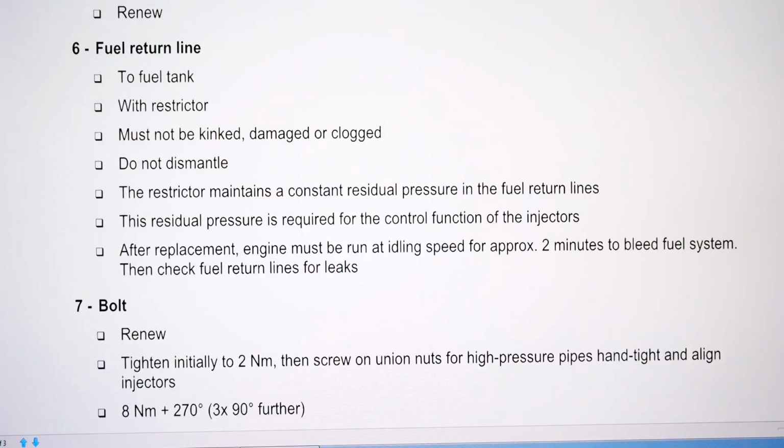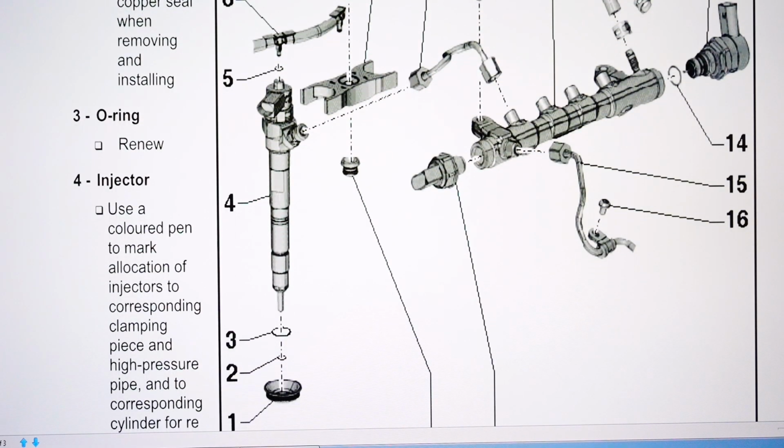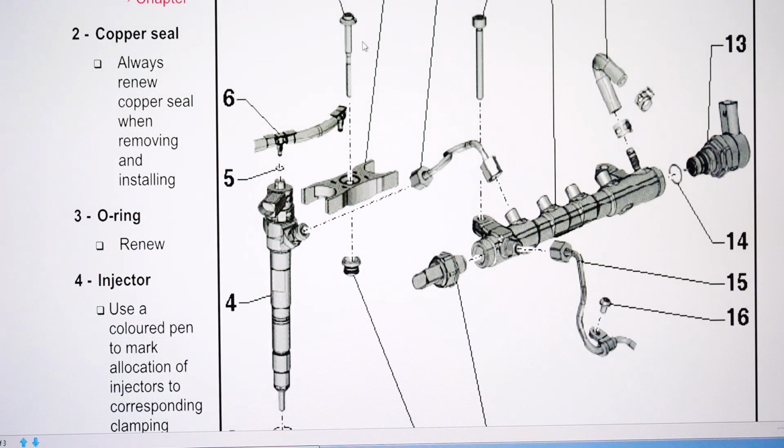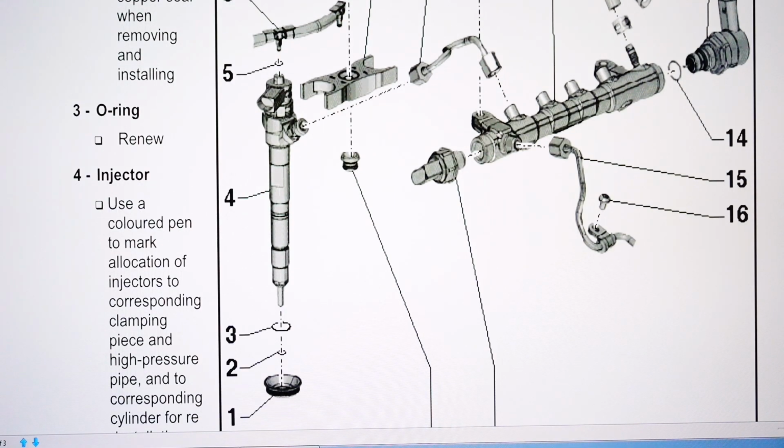So anyway, maybe get something out of it. As I say, it is preventative maintenance. This is to stop the blow-by. We knew that the injectors had become unseated, as a result of the bolt loosening up. We have seen those bolts snapping, which is what I expected it to be the case, but it wasn't the case. We got the guy on the road again, but we knew we had to reseal those injector seals. So there you go. Maybe get something out of it.